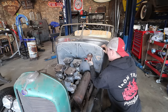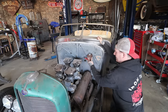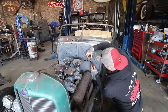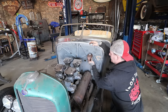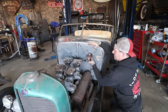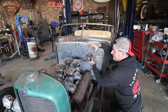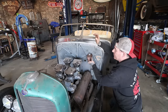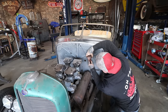Alright Steve, can you give me some feedback? It looks pretty good. I can go up, but actually it probably needs to favor down a little. So what I would say is I'm going to drill this hole first in the bottom if we get the height where we want it. I think somewhere roughly in there — or does it need to move? It's leaning towards the outside a little. That looks pretty good there. I'm going to do the bottom one — drill that hole, and then we can rotate it to level and drill the second hole. That way the first hole we can tighten it down and keep it snug so it's not floating around. That's real close to level and straight there.